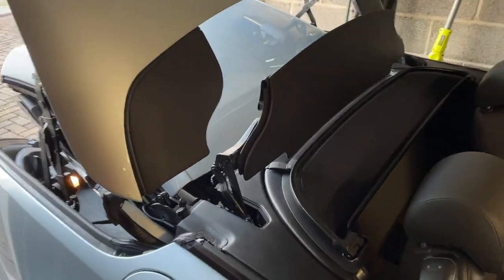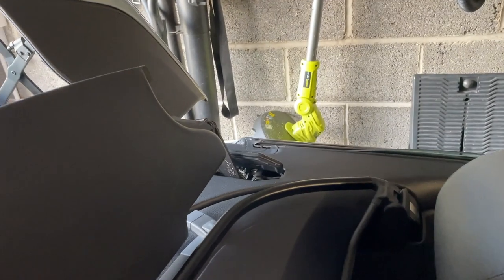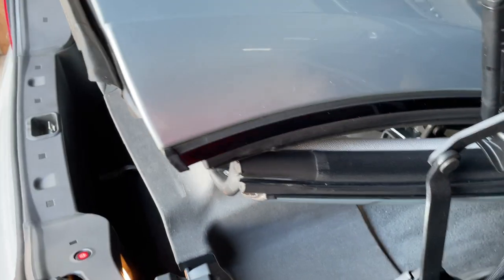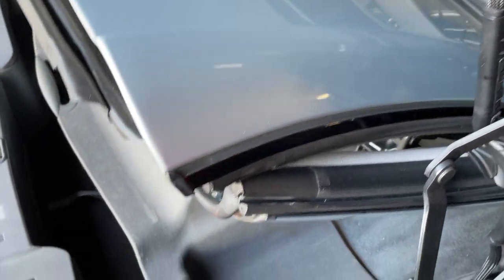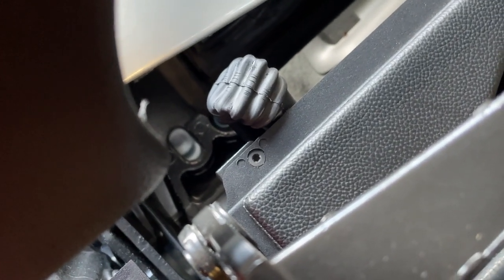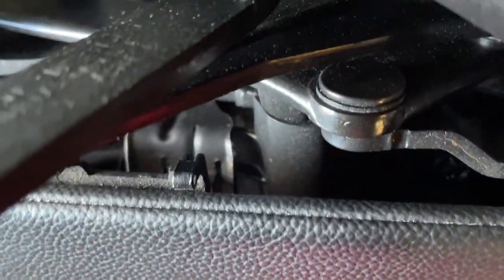To fix this, this should look like that — with a flap sticking up. So I'll just put the top down. I've put the top and the trunk in its open position just by pressing the red button, and what that allows us to do is get access to that screw there, which is a T20 Torx bit. We've also got to remove a bolt in here.